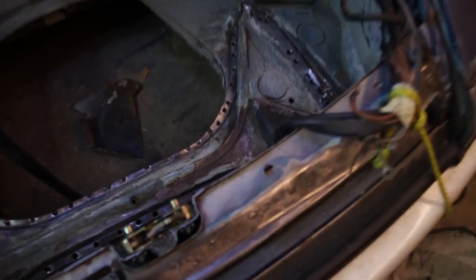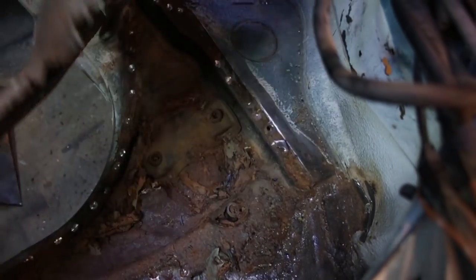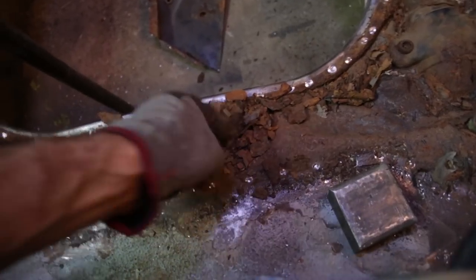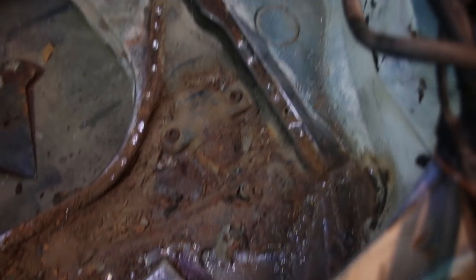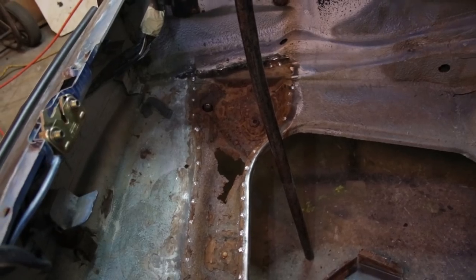I finally got all the spot welds broken free, so now we're about to reveal what is underneath this hidden cavity. The inside has remnants of paint left in, which is great — this part isn't too bad. But look down here — this is like a village of tetanus. Just pounds and pounds of flaky matter. I thought maybe I could figure out where the thin sections are and replace just those, but this looks like the whole front piece is going to need to be replaced. I need to go back to the catalog and order this front suspension pan, probably from Restoration Design or maybe Sierra Madre.